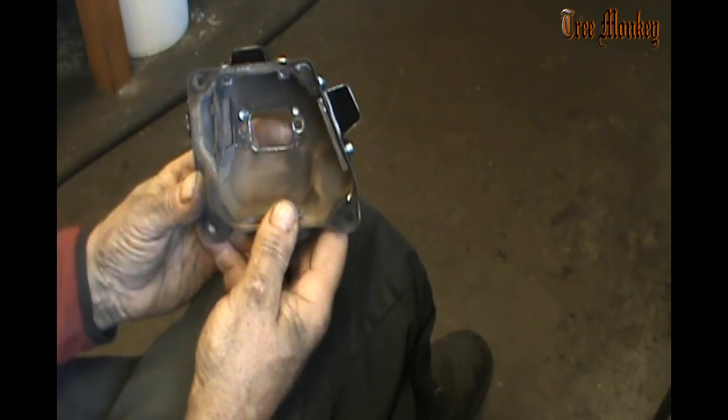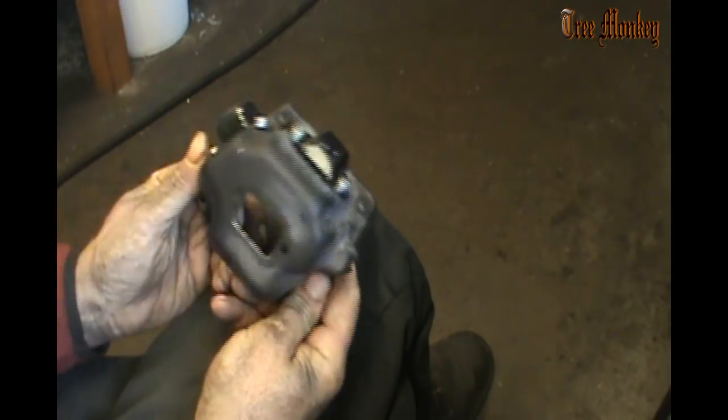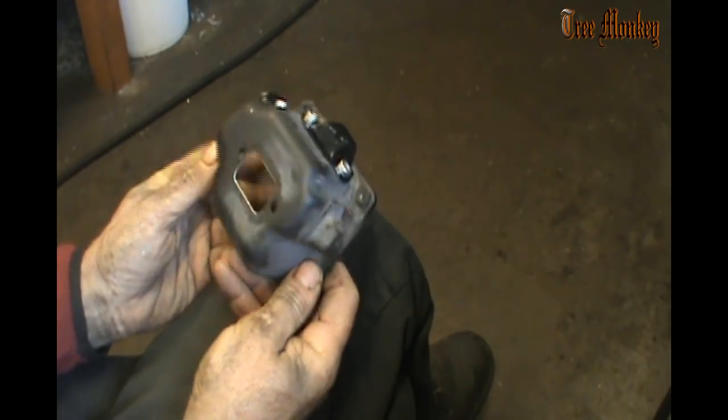This is a 660. We found that two deflectors, and this deflector is taller than this one. I have room for a tall one here. I don't have room for a tall one here. So I make two different ones. This one's about a half an inch tall. This one's about 3/4 inch tall. The pattern's the same otherwise. So that about does it for the muffler, and then we'll move on from here.